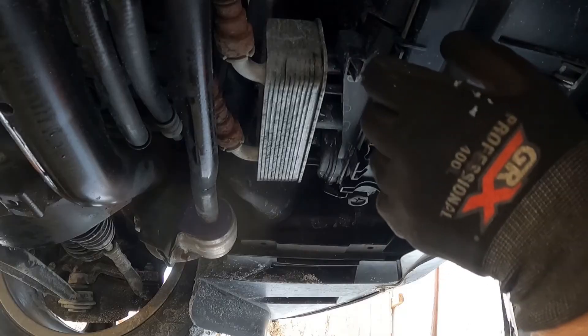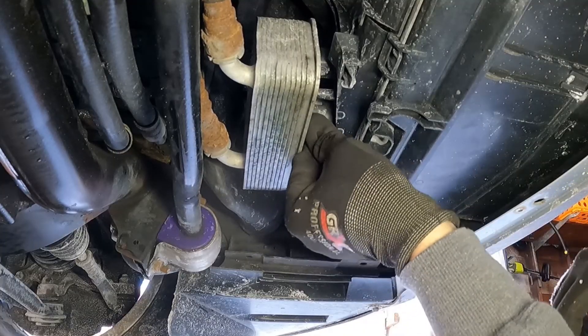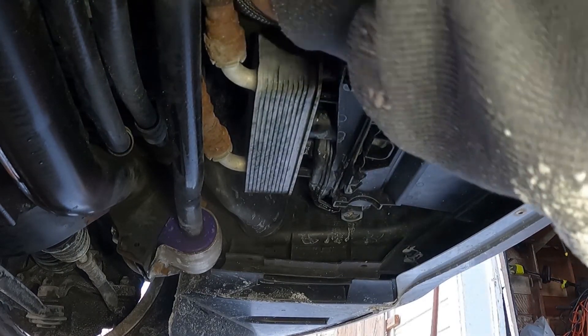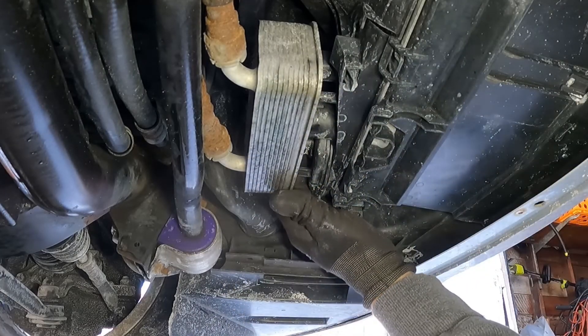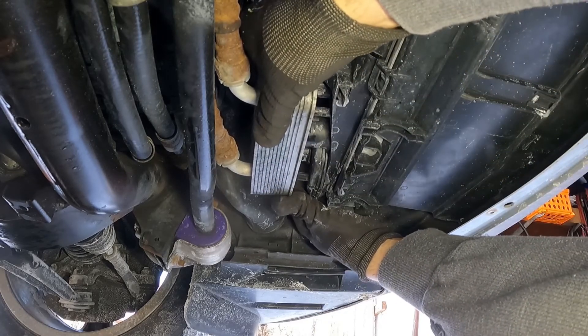You can see there's a drip right there — it's for the transmission cooler. I'm going to pop this off and see if I can replace just those O-rings and get away with that, hopefully without messing something up so I can't drive the vehicle. I already popped off the cap up top. I'll try to pop this little lock, and it came off completely. Trying not to get soaked — just slide this out.